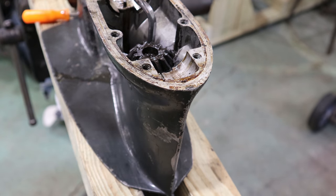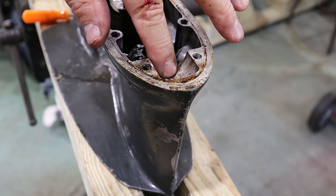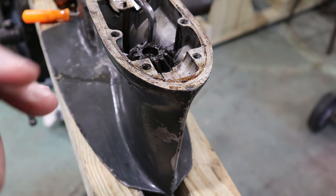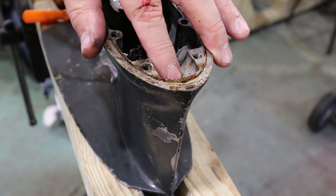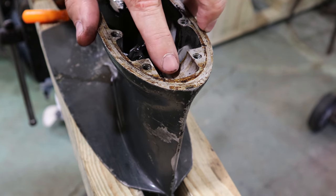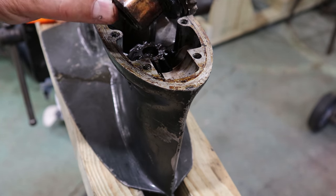There is no access to get it back out. It's in there, nothing you can do about it. But to allow for the tolerances involved between this bushing and this pin protrusion, if it's 44 thousandths worth of groove depth, have that be plus or minus 5 thousandths, and then this pin protrusion be plus or minus 5 thousandths. Honestly, you could get 30 thousandths worth of protrusion sticking out here and not interfere with the performance of that bearing by causing a crushing situation.